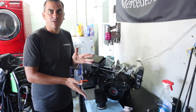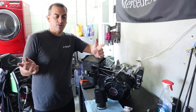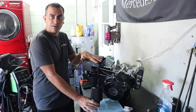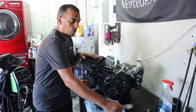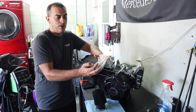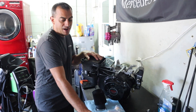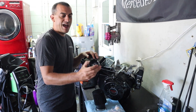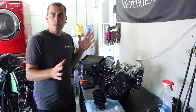The main plan is I got a little kit from Amazon — this is a Stage 1 kit. A lot of other places sell it, like Go Power Sports and so forth. It comes with the intake, so instead of my intake sitting so high up, now it should be down low so I have plenty of clearance to the buggy. It also comes with a fuel filter, series of gaskets, hardware, jets, and a spark plug. It also has the bracket — I think it's for a throttle cable — and then the adapter, which is the big thing you need.